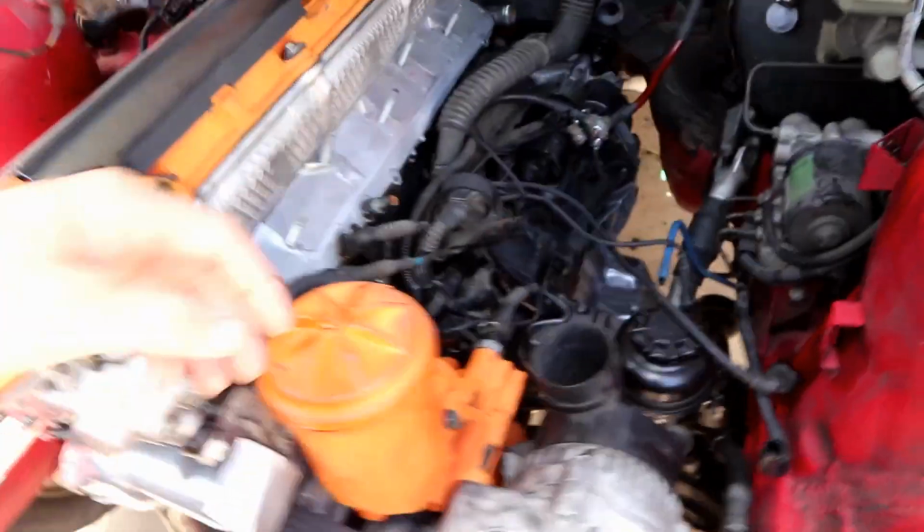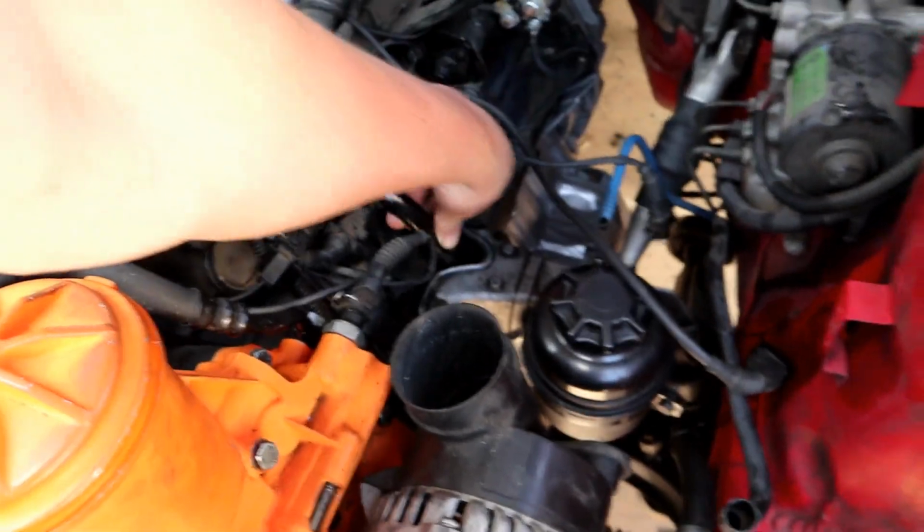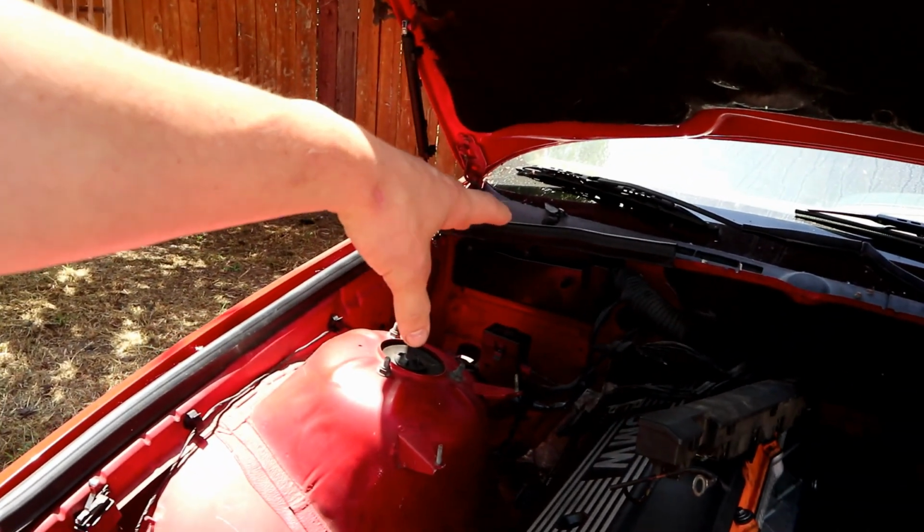So I went through and that's the Autotrans connector. There you go. I spliced all that and then I tied off some other wires over here. You got the ECU in, or the DME? Yeah, I got the DME in. I didn't plug the Autotrans harness into anything, so I don't know if that's gonna work. When we try to start it, if it doesn't start, we can start going through things and figure out what's up with it.